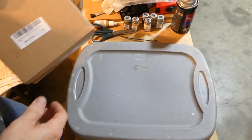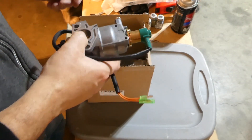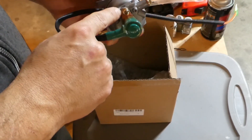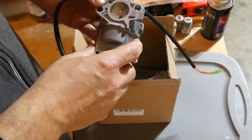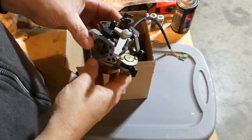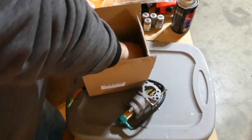In the box, this kit is basically a tune-up kit for 14 to 18 horsepower single cylinders, like you might find in a Honda generator. We compared the carburetors — they're basically the same except this one comes with an anti-backfire sensor or device. We may change out the bowl because this bowl is a little longer. The carburetors are pretty much identical, although the original one does have a petcock integral with the body of the carburetor, so we're going to have to add an outboard petcock.